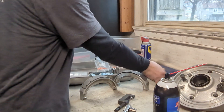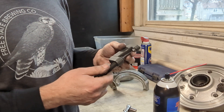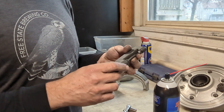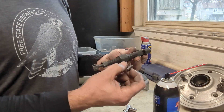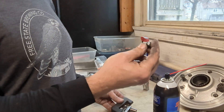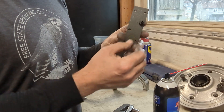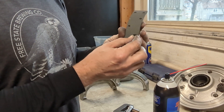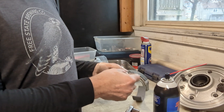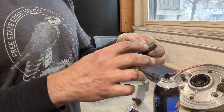What I'm actually using is a chain breaking and installation tool — Pit Posse sells this one but they're made by lots of different companies. You normally use this tool to install the rivet pin on the master link when putting a chain on a bike — of course BMWs are shaft drive so they don't have chains. One of the pieces in the tool is a little mandrel that I ground down so it fits right into the holes where the rivet heads go on the brake lining — a nice tight fit.